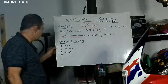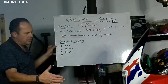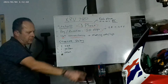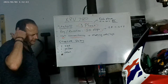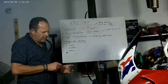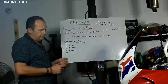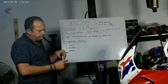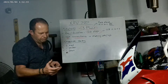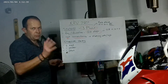The starter relay consists of four wires - two red on the front, and a yellow and a green at the back which engage your starter from your button on the top going down. Now if you have a look at the relay box, the OEM one is a black unit and the aftermarkets are green. Where your plug goes in you'll see your red wiring coming at the back of them. If you buy an aftermarket starter relay and fit it similarly as it is in the bike currently, you'll see it won't work.